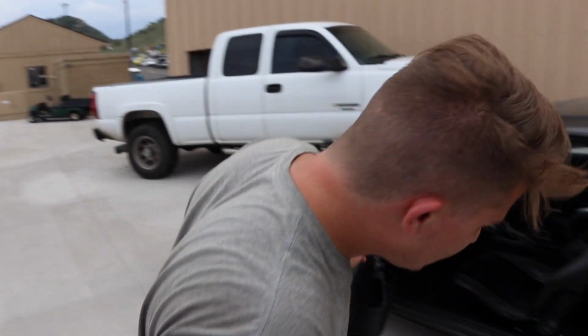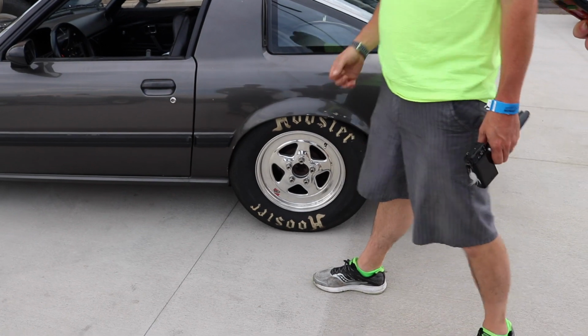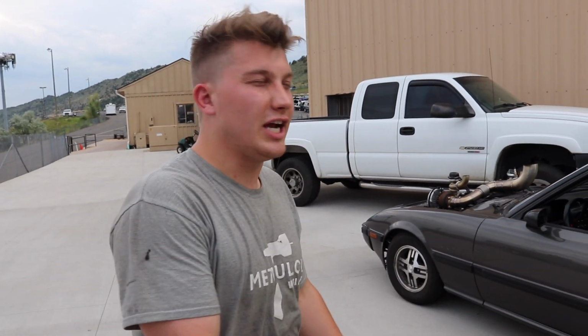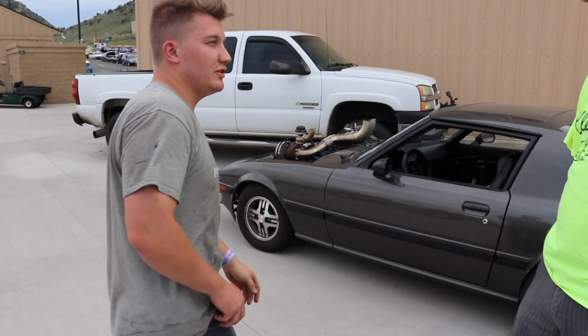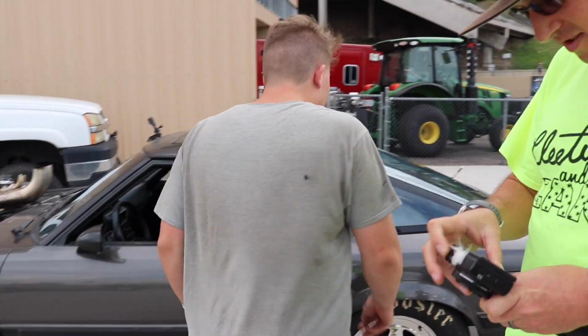Well, dude. Oh, dude, no, I definitely messed something up on the axle too, because look, my tire is rubbing on it. Dude, I definitely broke something on the front. I honestly might have rotated the pinion like what Derek just did. It looked pretty bad. It might have rotated the whole pinion. It came up all crazy. It felt so shitty. I honestly think it might have rotated the axle tube housings. It didn't look good back there, dude.